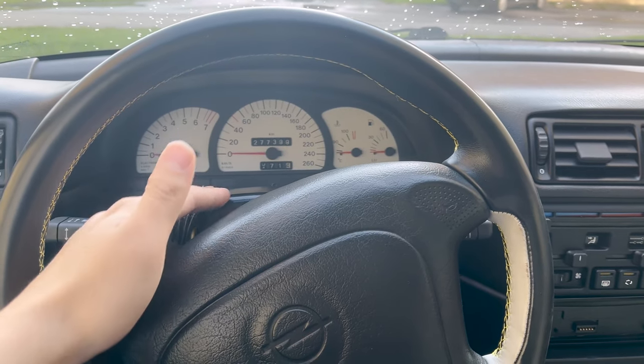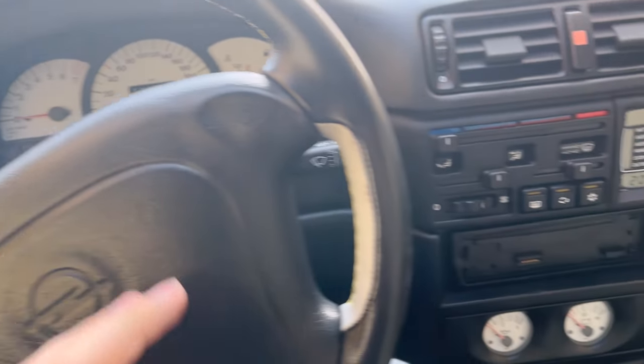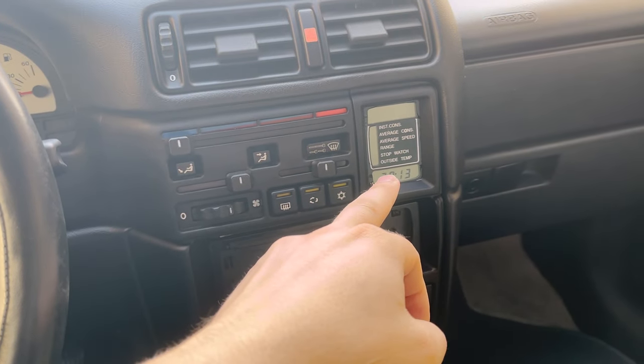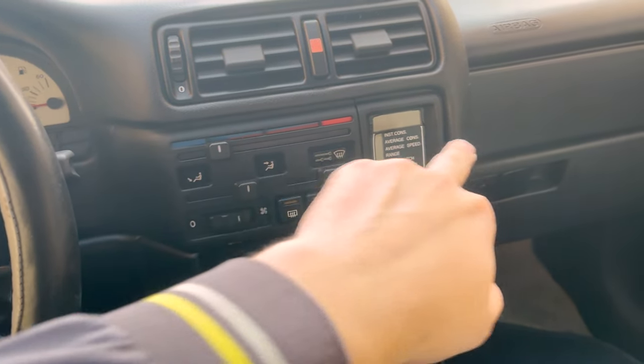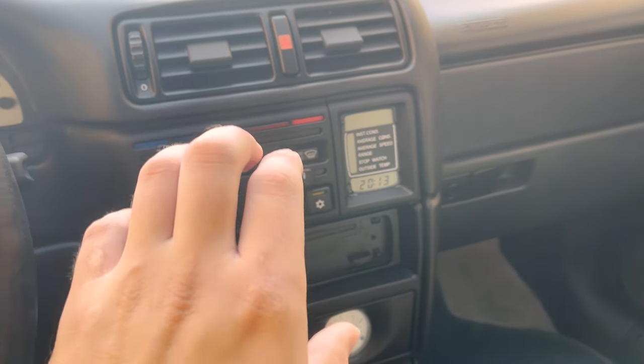Right now I have one LED there, which is shining from the side. But I thought I will get a cuttable LED strip and put a full LED strip there. I have to remove the plastics around the steering wheel and around the speedo. Then I have to unscrew these screws that are hidden here, remove the computer and then remove the glove box, because I have to disconnect the cables that are moving the valves behind the dash.